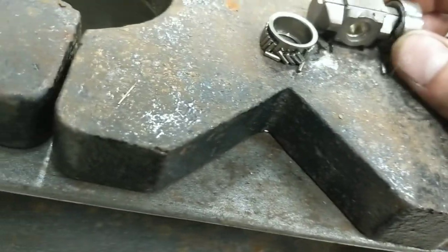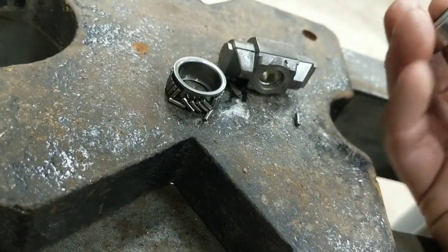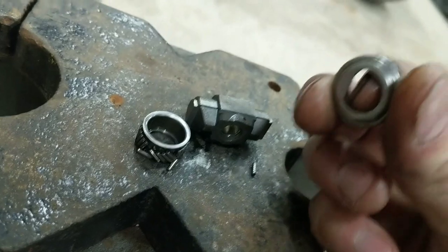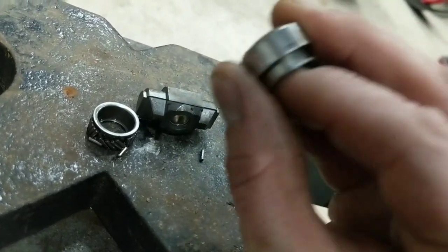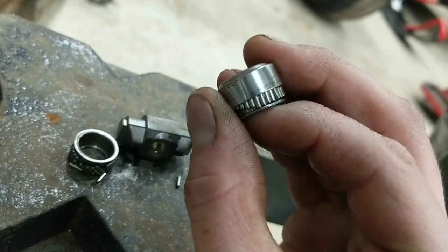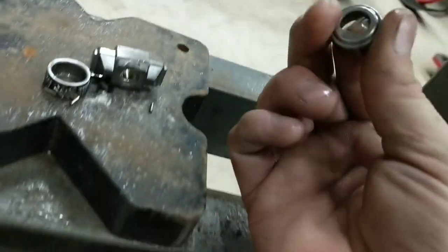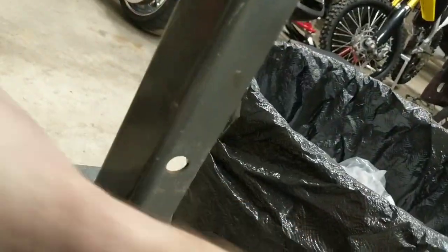These needle bearings, because they are cageless, can actually escape under enough valve spring pressure and RPM. They aren't sealed - there's nothing that actually retains any of this together. So if this started to walk out of the rocker arm under a lot of valve spring pressure and RPM and these needle bearings start to come out, those are small enough that they'll actually fit through the oil pump sump. The screens on the sump are not actually small enough to keep stuff like that from going through. So the best place to put this is right in the garbage, and I'll just repeat the process for the other 15.